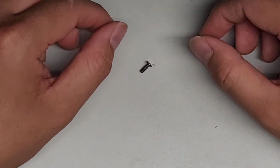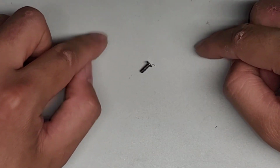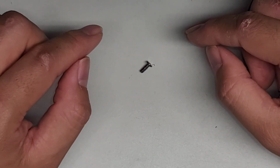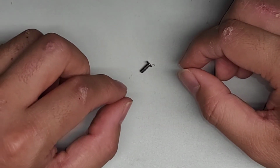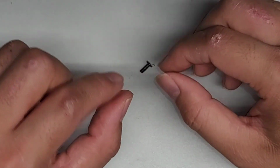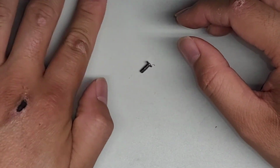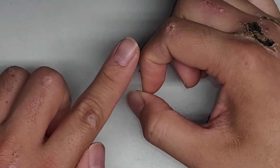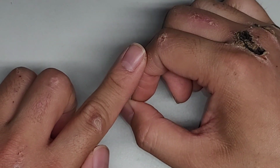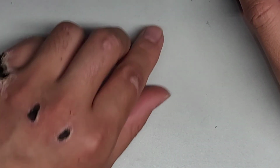On a lot of their laptops, if you've seen my videos, they'll put little rubber covers with adhesive on top. And again, adhesive isn't brittle, it has that gummy texture where it's slightly rubbery, and that basically is to prevent the screws from turning themselves out. So if there's some sudden shock, it might turn a tiny bit, but it'll go back because of the rubberiness of the adhesive.